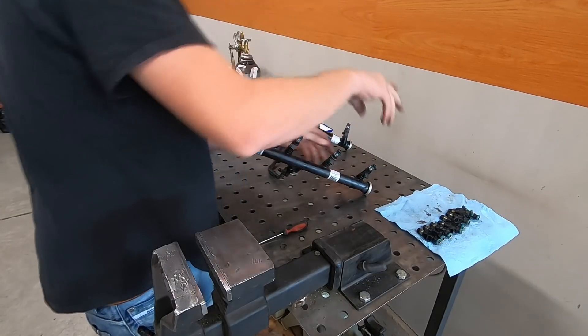We went for the drive, but then the symptom — the surging and the pulling — didn't really change. So the next thing we had to look at was spark advance.